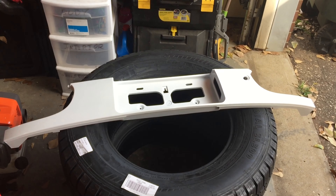This is our new rear finish panel — I know it's hard to see, I'll give you a shot in just a second. So this is our new panel, it was purchased online. It comes in a black ABS plastic, and I painted it using Rust-Oleum automotive enamel and Rust-Oleum automotive clear coat. It's a pretty good finish — it's not perfect, but it's not a perfect car, so it really fits with the overall condition. It's not going to look out of place. It's got a couple coats of white, a couple coats of clear, and then I did a hand wet sanding with 2000 and 3000 grit.